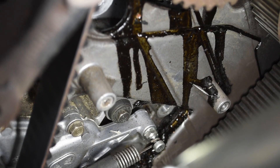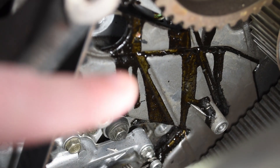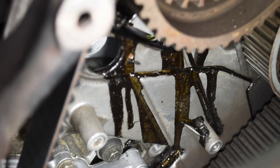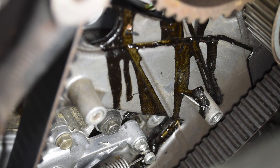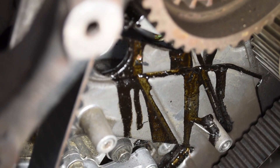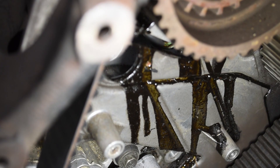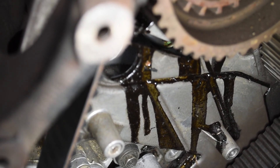Before we get started, because we're going to be filming in this area a lot, I need to address this black stuff here. It looks like a really gnarly oil leak but I assure you it is not, and there's nothing to be concerned about. What it is is melted epoxy potting from the cam position sensors. Right there is a cam position sensor, and that would have originally been potted all the way full with this epoxy that has now run down the inner timing cover face and down to the top of the oil pan. It is something that just happens on these cars and has no impact on the function of the sensors. On my car in particular, this has been the case since 230,000 miles.